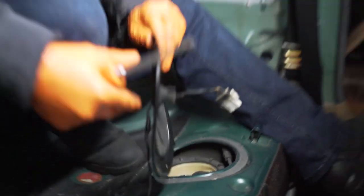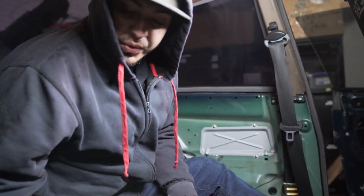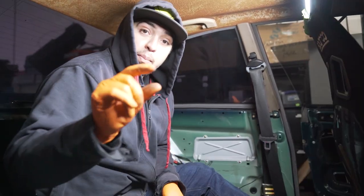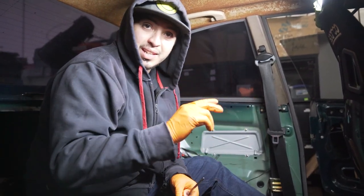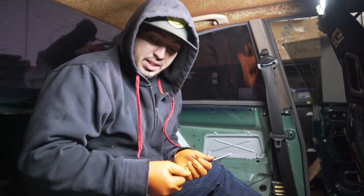This one actually has two one-time-use hose clamps — cut them, but make sure you have replacement clamps. Try to buy hose clamps specific for fuel lines. Pretty much the whole thing is smooth on the inside so it doesn't cut the actual hose when you over-tighten it.